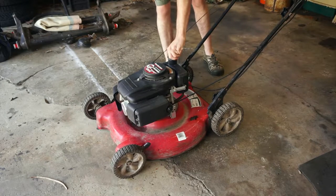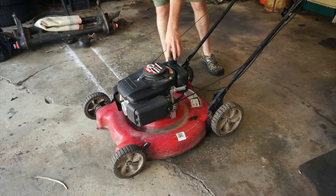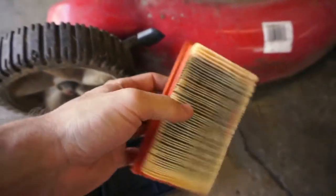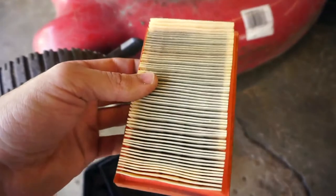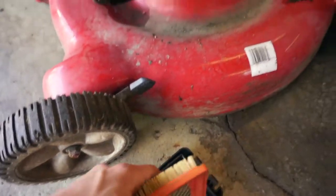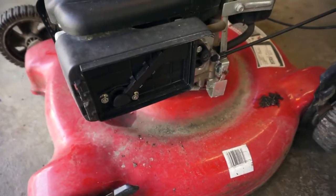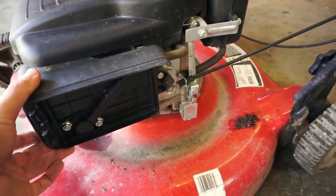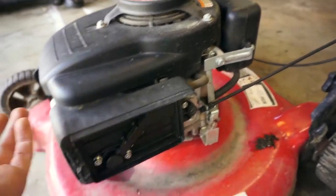Nothing. Let's see if we have gas — no, it's bone dry. So that's actually not a bad sign. I'm going to take the air filter off and take a look at it. It actually doesn't look that bad — I was expecting it to be way worse and possibly drenched in gas. As soon as I took the air filter off it smells terrible, definitely full of old fuel. I don't know if this lawnmower's had gas in it this season. Everything just smells really old and stale. Probably the person put it away with gas in it, went to start it this year, and it just wouldn't go, so they threw it out.